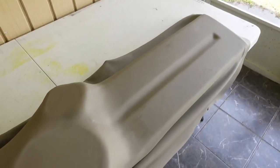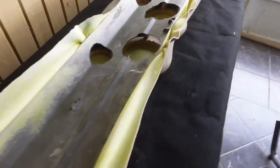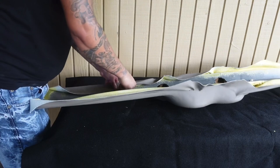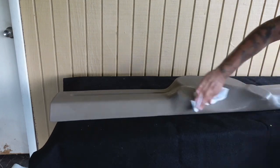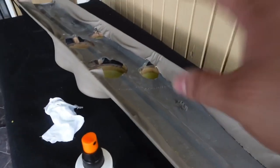Now it's already ready, so we're going to fold over this side of the vinyl and glue that up. It's raining already. I've flipped over the panel — we've got one area that still needs to glue up a little bit more, but before that we're going to overlap these sections. For that area right there I'm just going to staple it with an upholstery stapler — I'll back down the pressure so it doesn't blast holes through it.